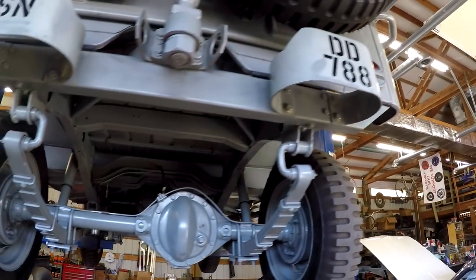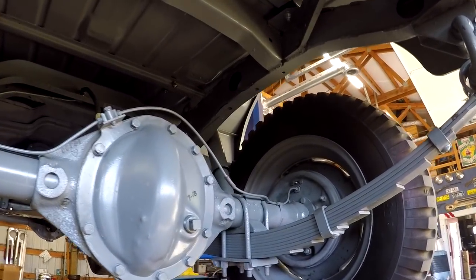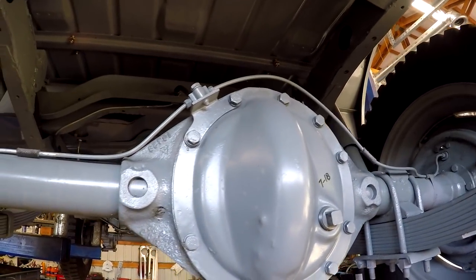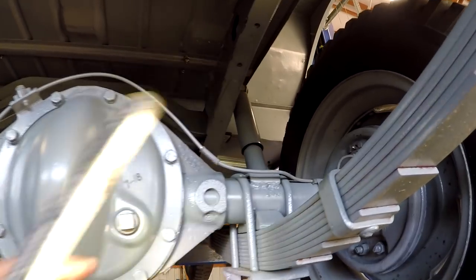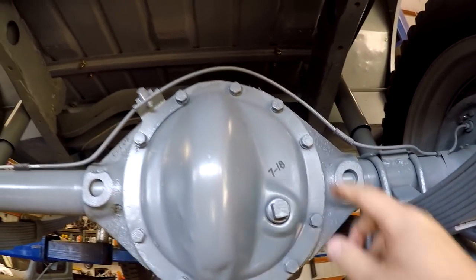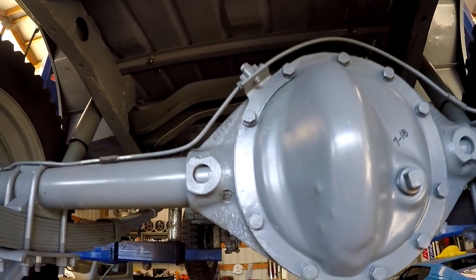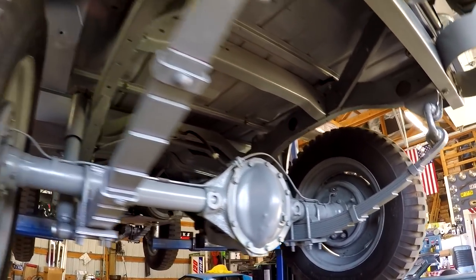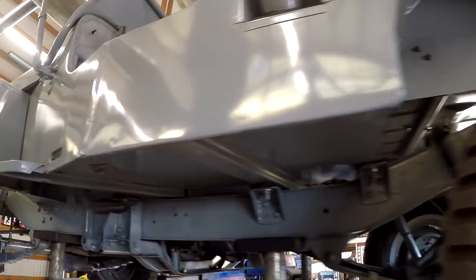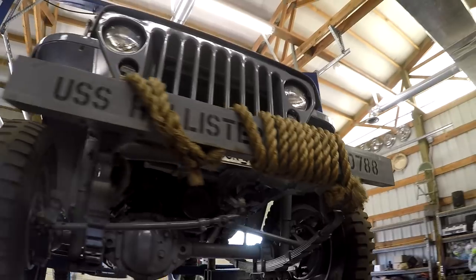It is actually a clean little Jeep and looks good. The rear end is a Dana 41. So we've got a Dana 27 on the front, Dana 41 on the back, and a Dana 18 transfer case. I checked all the fluids. One of the ways you can tell - a Dana 41 has a round pumpkin here, and a Dana 44 has kind of a squared-off one. This is what a CJ-2A should have - that configuration. Hopefully that gives you a good look. If you've got more questions, give me a call - I'd love to answer anything. Someone's going to get a nice little Willys here.